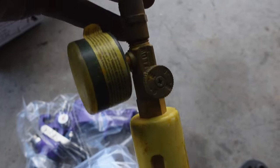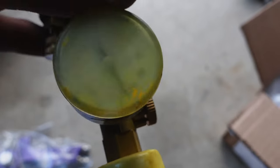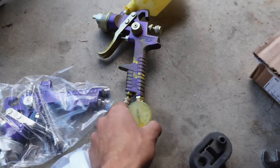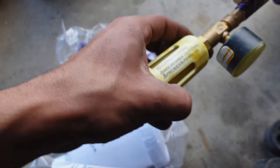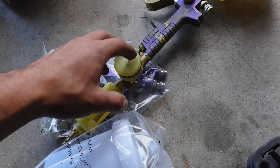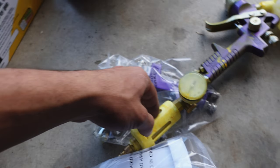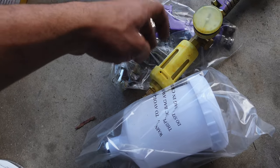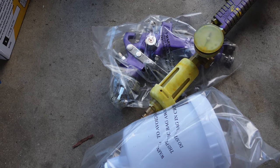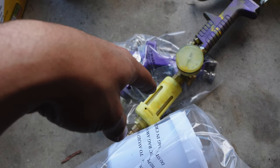I also have an adjustable air pressure regulator — it's kind of hard to see since I got acetone on it and it messed up the plastic, but I picked that up at Home Depot. I also got a moisture water separator, also from Home Depot. I think those two in total were about 30 bucks. The little red Harbor Freight filters kind of suck — after about two minutes of spraying you start to get moisture out of the gun. Whereas with this one I sprayed pretty much the whole paint job without getting any moisture, and only towards the end did I notice a little water.